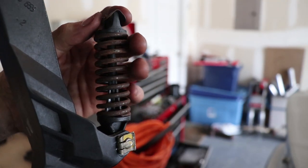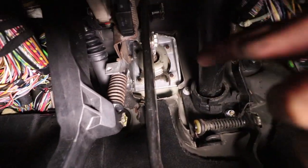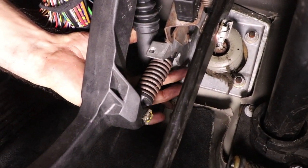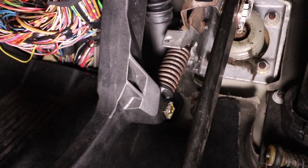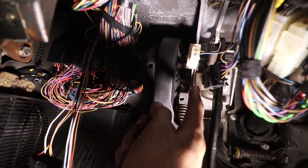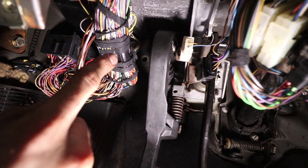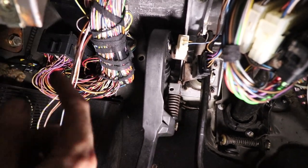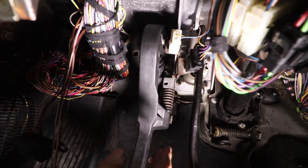This thing is a total pain. To get it on I had to use the zip tie trick. There are two little clips — the middle upper point and the main spot — with a little metal retainer. Don't do this until you do it last because getting this in where the master cylinder is a total pain. There's a stopper on the back and you have to get the pin in there. Undo the very top one, then get to the middle one, pull it off to the side a little, wiggle it and eventually it'll go in. Then slide the whole assembly on, clip the top two clips, and do the spring trick by compressing it with zip ties.